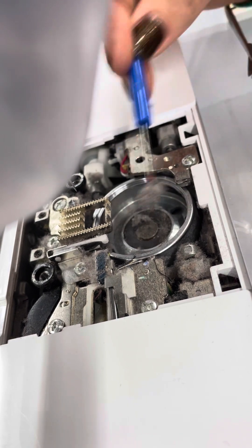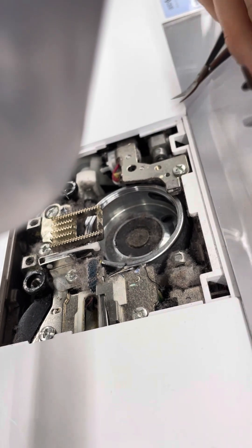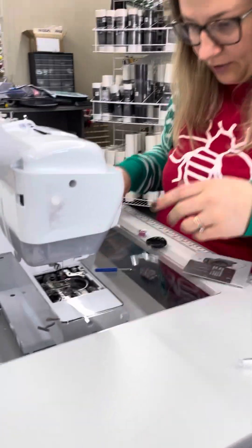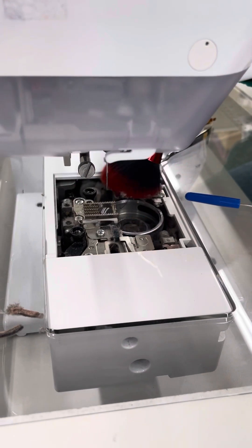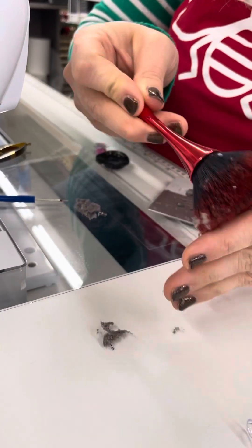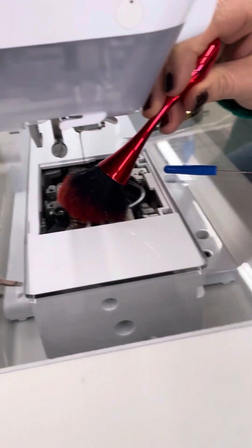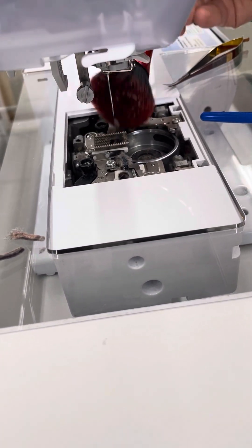You can use a small vacuum. If you've been professionally trained to clean machines, they do use canned air, but I really wouldn't recommend doing that at home because if you have this much lint in your machine, you don't want to be blowing it deeper in — there are sensors in there. Instead, I'm going to use this Martelli brush. As you can see, it's getting into all those pieces — it looks like a beautiful makeup brush — and it comes out really clean and sparkly.